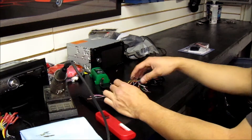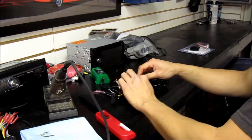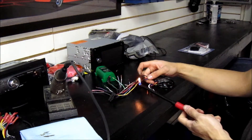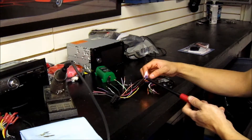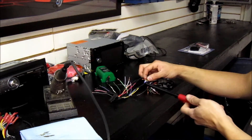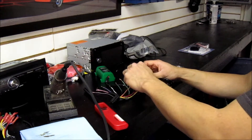I usually use my butane torch but I forgot it, so I'm going to use a regular lighter — something you probably have at home. It takes a little longer but we need to get the job done. Slide the shrink tube across your connections and apply heat until it grabs over the wire nice and snug. I like to do this in stages — do your function wires first, then audio wires. Once it's cooled, lightly inspect with your finger to make sure there are no burrs sticking out. If you prick yourself, you'll need to go over it with tape.